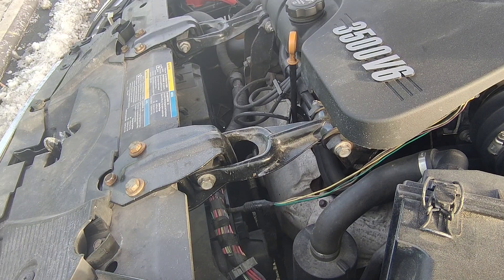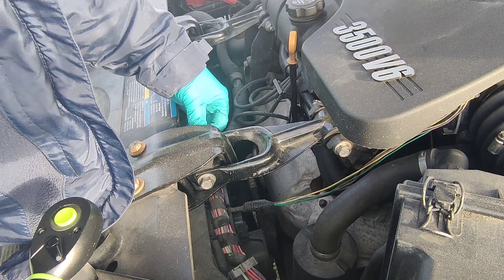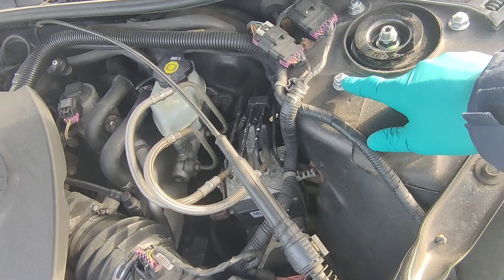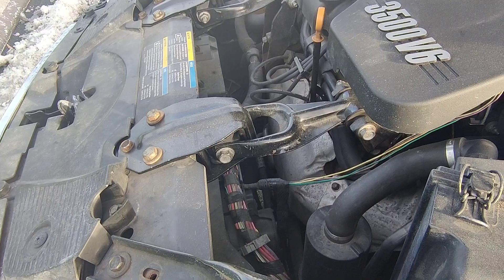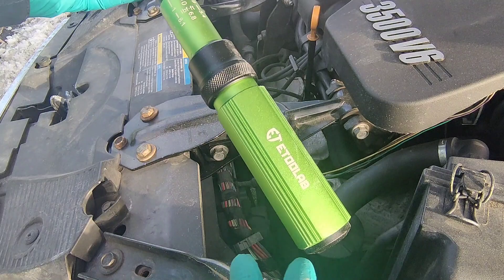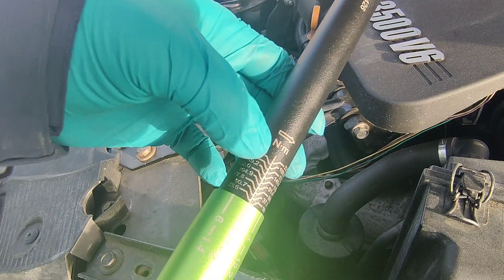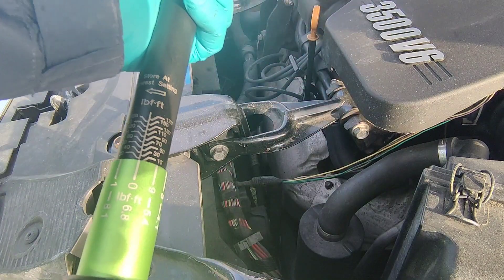Okay guys, I'm back. I'm going to torque these to 35, this one here for the mount to 50 foot-pounds, and then these right here to 24 foot-pounds. This is the nice torque wrench from the guys at E2 Lab — thank you very much. The foot-pounds scale is right here and the Newton meters are on this side. So now let's set it to 50 foot-pounds.